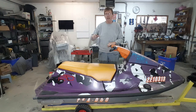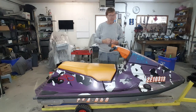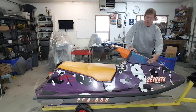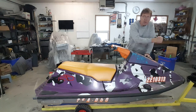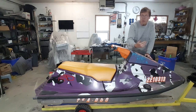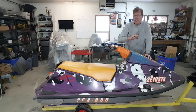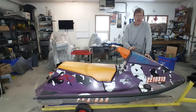Getting the white onto this thing, getting the blue onto this thing — will the blue cover the white? Will the blue look different on the 2K than on the white? How do the stickers peel off? I'm going to paint this area white, apply the decals on the side, then put the blue over the whole thing and peel those off to reveal the call letters in white. I'm also going to spray some pinstriping on the side — not to make it look good, but to see what happens with that base near the white. These are things I need to understand before I even go near the Mustang.